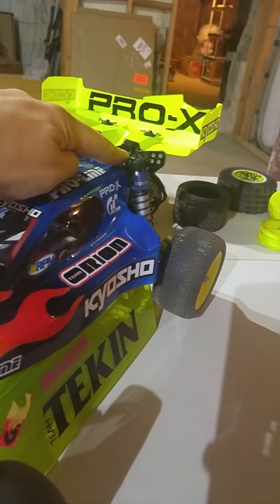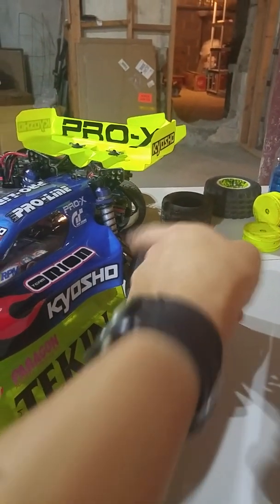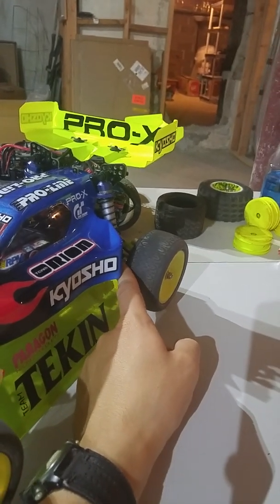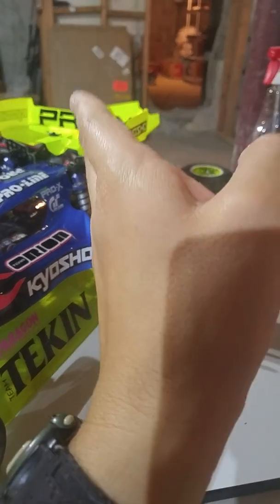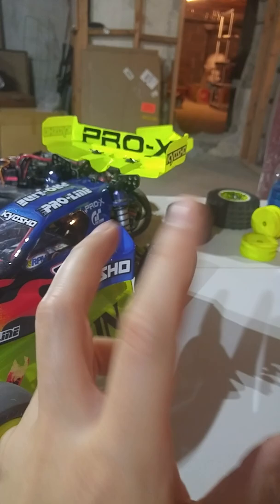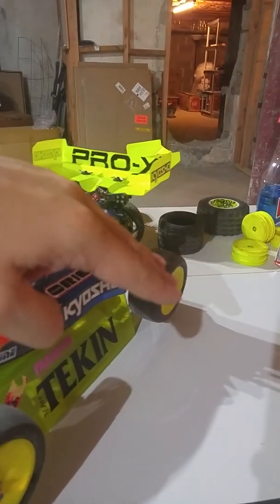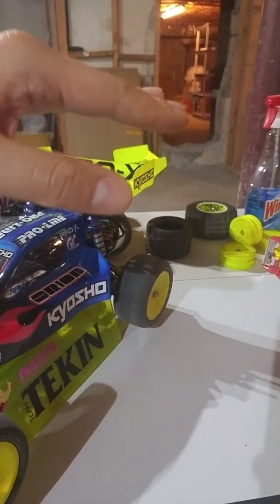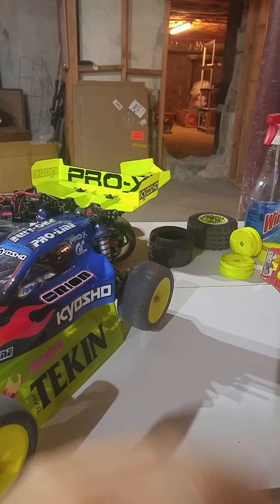If I'm all the way on the inside over here, and I'm, let's say, on the middle hole on the bottom, I can either move the bottom hole out, and that would make the average mounting point out a little bit, so that the suspension would be a little bit stiffer effectively, but because it's a higher starting angle, the progressivity of that suspension would also be higher. So as the suspension compresses, it would get stiffer still. So that's one thing you can do.